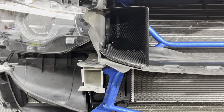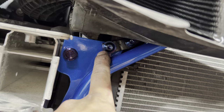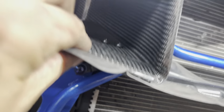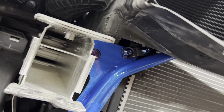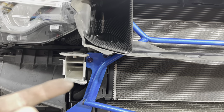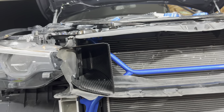I'm super thrilled — I was able to get the Eventuri scoops mounted. All I did was drill a 3/16-inch hole, used a small metal bracket, screwed the bracket into the brace, then used a screw and nut to tie down the scoop. It's actually on there even more firmly than before with just the push clips. I had titanium hardware sitting around and everything worked beautifully. Note to Lower Class Garage: you can drill a hole right on this bracket to mount the Eventuri scoop.